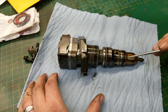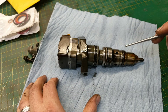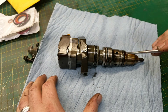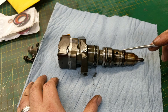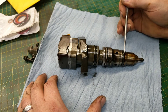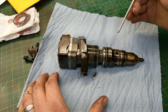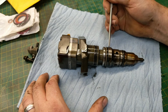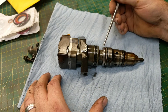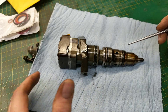From the tip of the injector down, it sits inside a cup, and behind that cup is coolant that keeps the injector cool. This is the actual tip that sprays diesel out, but it sits in a cup — there's a seal and an o-ring there, which are pretty important. From one section to another is a chamber where the diesel fuel sits, going into holes. Then there's the high-pressure oil system. If any of these fail you can mix fluids, and you really don't want that.